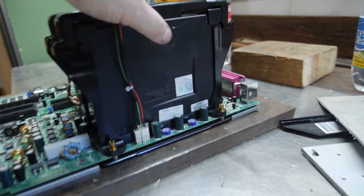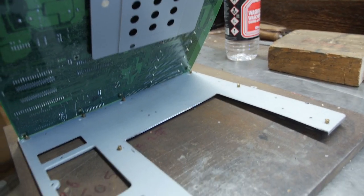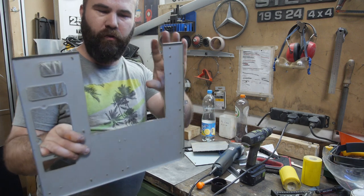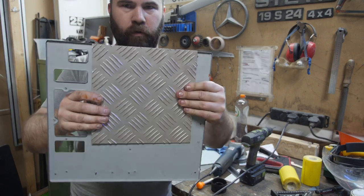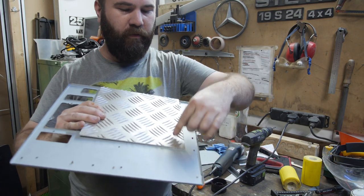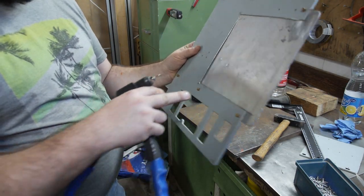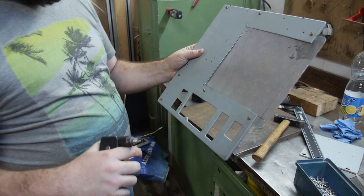The motherboard fits now! The reason I need to make so much room is this really big metal backplate at the bottom of the motherboard. The motherboard tray is still pretty strong with not too much flex, but I still want some extra support. I'm thinking this aluminium plate — I'll use rivets to mount it and then cut it out so it has a strong back support. I'm installing this aluminium checker plate with rivets, and after that I'll just grind the middle hole out, then the motherboard tray will be sturdy.